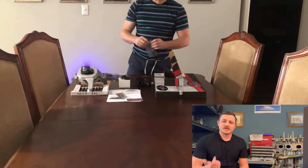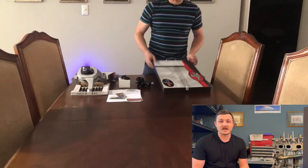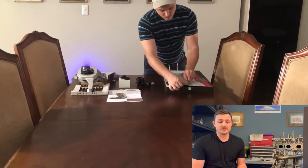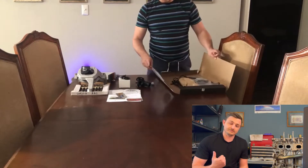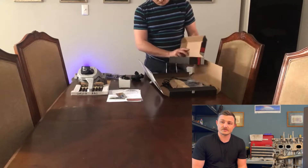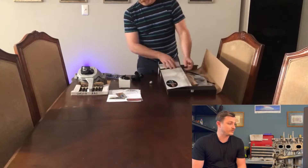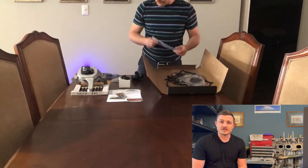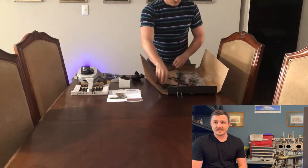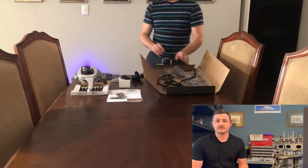Here I am opening up all the parts that I needed to buy for this particular build. In this case I'm cracking open the Engine Tech gaskets set — I needed to get one for the oil pump and then a general engine rebuild. You always want to replace any gaskets anytime you break that seal, because it's just not going to seal the same again.